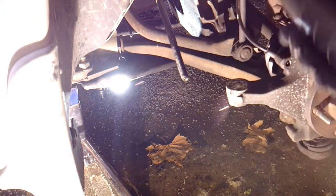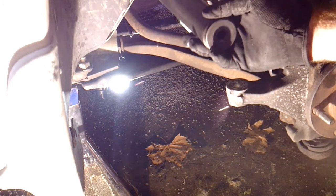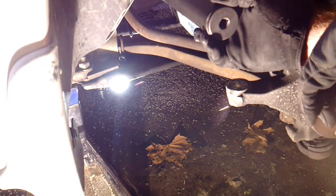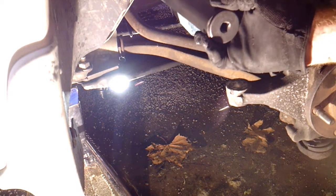So all you do is slide this in there, get it over the tie rod, and then you just turn that bolt down until it's tight against the tie rod. And then we'll just put the ratchet in here, and I'm going to have to move you out of the way to get my arm in there and my leg and tighten down, but you get the drift.